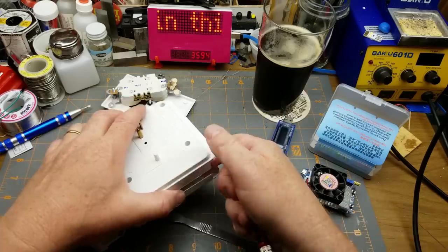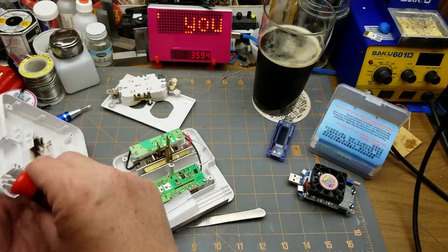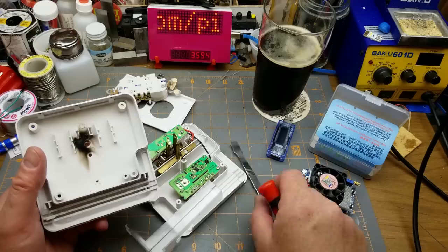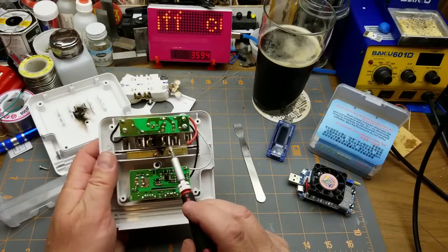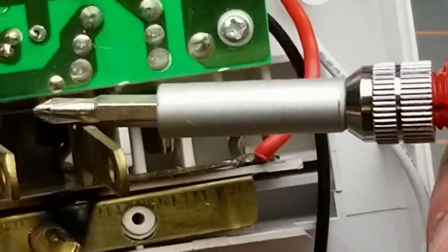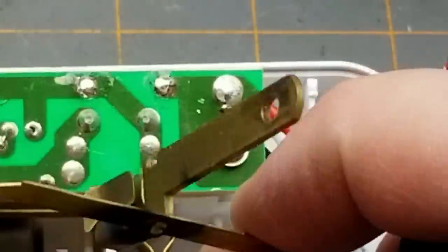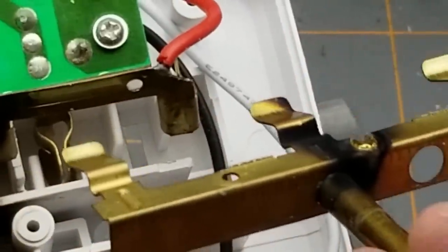Back off — four screws out. Oh my — that was unexpected, but that makes it all the more interesting. Here's the hot and here's the ground. The ground is just metalwork that goes straight through, but the hot has somehow bent down and arced into there. That riveted perpendicular piece has obviously flashed over into the ground.